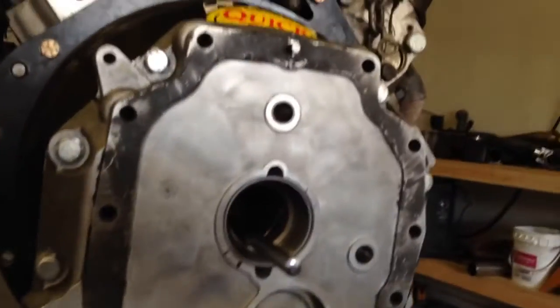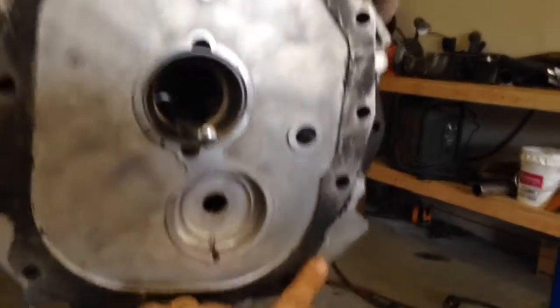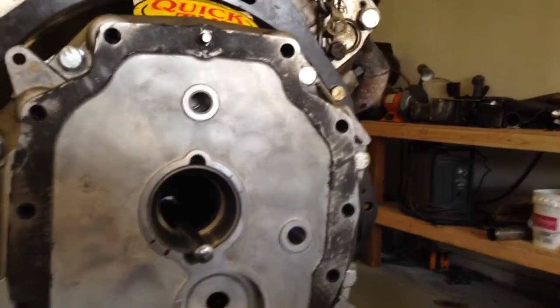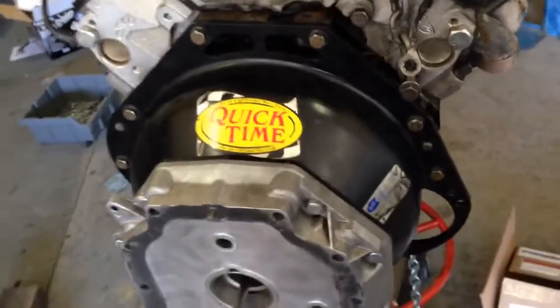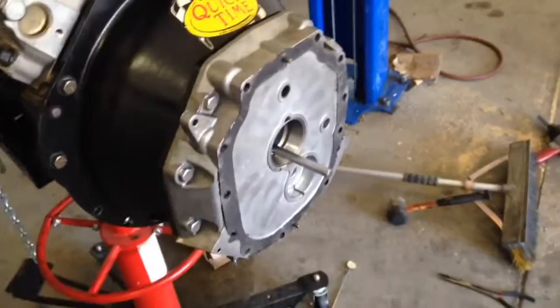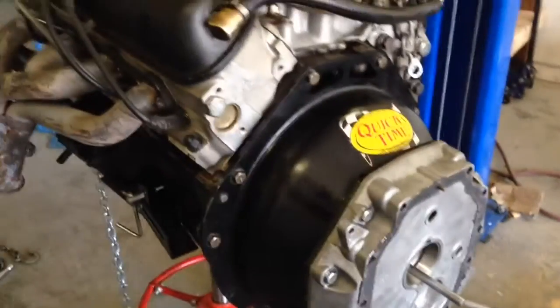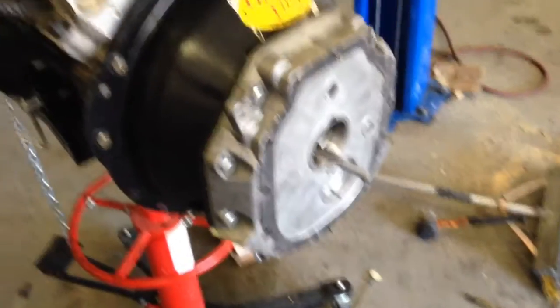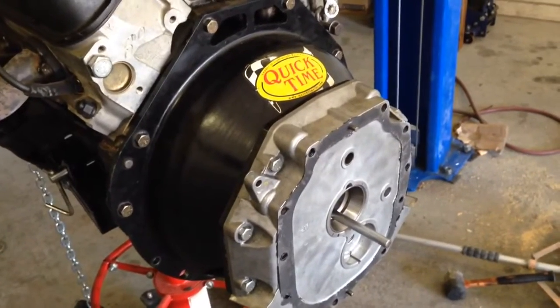This method accounts for everything. A lot of people say you have to trust that the dowel pin holes in the front plate are accurate — which they generally are — and that the drilling in the bell housing is accurate. But with an aftermarket bell housing, you can't assume that. Especially if you've had any line honing done, which raises the crankshaft up in the bore a few thousandths off its original centerline. I highly recommend this for anyone running an aftermarket bell housing.